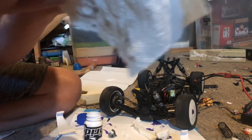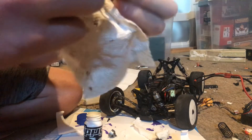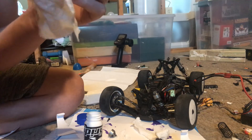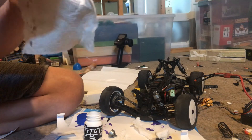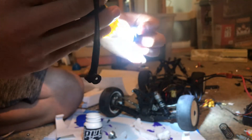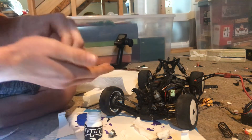So now you have your main shock shaft right here. You're going to want to really clean that off. This is not very in-depth but it's still helpful for some people that wouldn't know. There's just a plastic ring for mine — you might have metal, but mine's plastic. You can slide it back in and feel for any little spots that feel rubbery. Mine don't feel rubbery but they've been leaking. Set it on a paper towel over here. Get a flashlight or a light of some kind, just check the inside of your tube, make sure there's no scoring. Maybe take a finger and put it in there to make sure there's no scoring. There's a little something down in there that I need to get out.